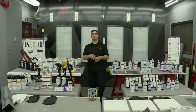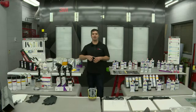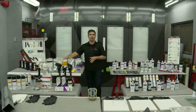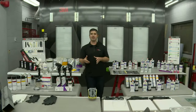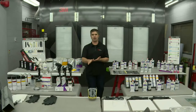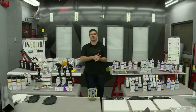Yes, so they do, and particularly in the area of aluminum is where many of the OEMs will have bulletins or procedures saying before you even apply body fillers, you have to use an epoxy primer to protect that aluminum surface. Some OEMs, Ford in particular, call out our Quick Grip body filler that can be used directly on aluminum in some repair instances, but we have to make sure that we're staying within that 60-minute time frame from when the surface was exposed, so when the abrasive exposed that aluminum surface, to when we actually complete the application of body filler so that it does not start to oxidize.